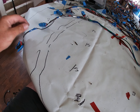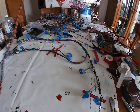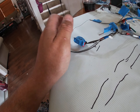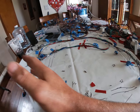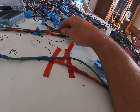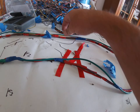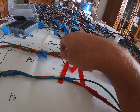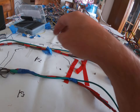The wiring harness for the fuel injector is finally done without its rope attached. I did them in layers - this side you have ground and then 12-volt supply. I ran all my grounds from the even side and the right side and left side of the engine. This bundle is from the driver's side or left side, and this bundle up top with the white, yellow, brown, purple is from the passenger side or right side. I tied those together because each bundle is individually wrapped.